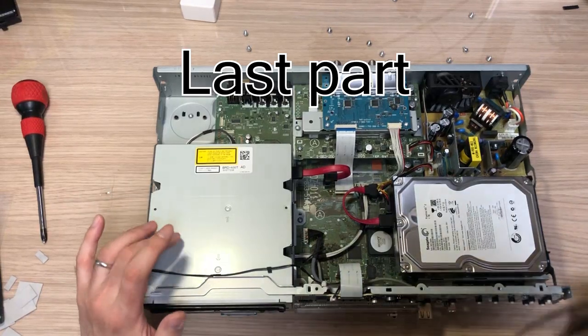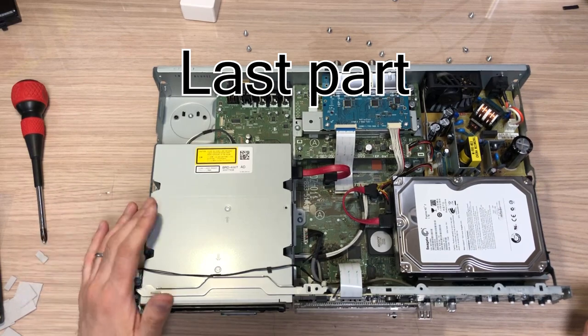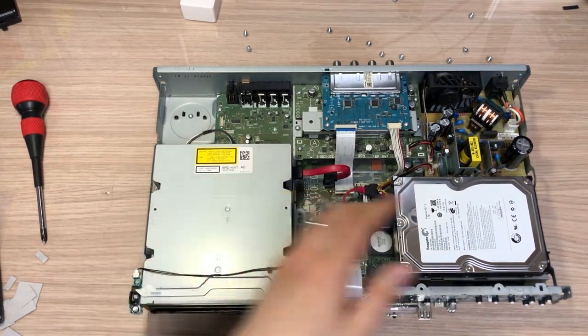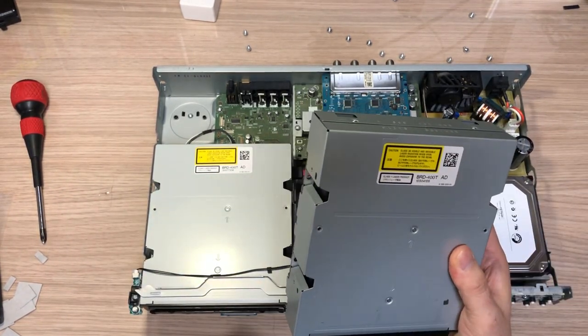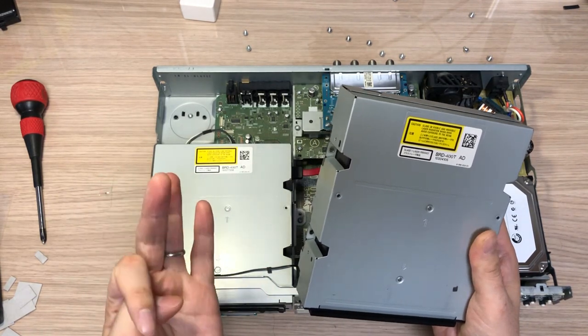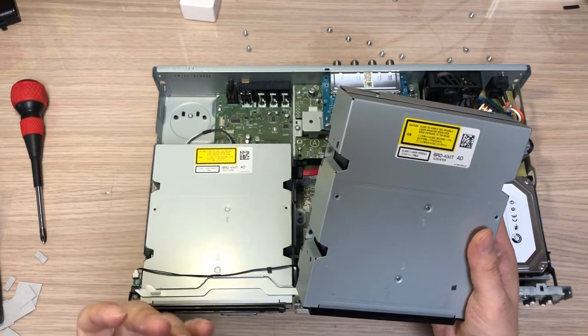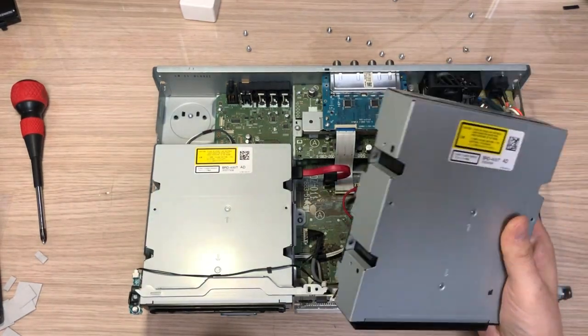Yes, the drive I just replaced was working perfectly. It recognizes BDRE media. And this kind of BD drive, normally if it supports DVD minus R, DVD RW, BDR and BDRE, that's most of what the drive is capable of reading and writing.